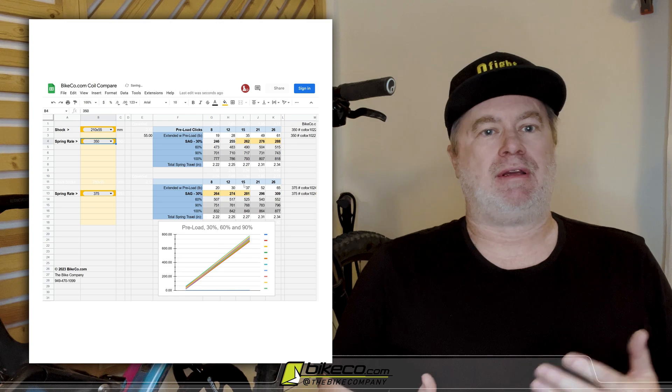So there still is a lot of you having to look at what your bike's doing or understand what your bike's doing, and work with your resources. You can kind of back into it if you know this is what my bike is performing like and I've got my compression settings correct and my high-speed compression correct. We're not trying to tell you here's the be-all end-all, but we thought it'd be fun to have a calculator that people could look at. If you have a shock on your bike and you're thinking you're not using your full travel all the time but the sag is set correctly, this will give you some options to look at. Vice versa, if sag is set as low as you want and you're just running through travel, you might look at running a different preload and getting that ramp rate up with your coil spring.